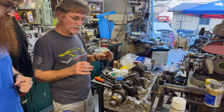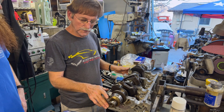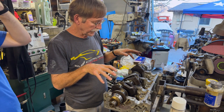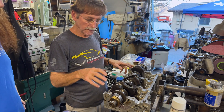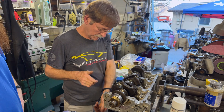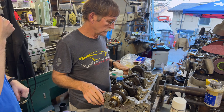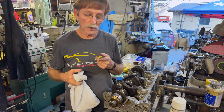I wanted a nice tight engine because these crankcases will expand two to three thousandths at temperature. If you think you can set them up at two thousandths clearance like a small-block Chevy or LS, you're going to grow two to three thou and then you're going to have low oil pressure. Chevy initially sold these with undersized bearings - this particular engine had standard on one side and one-under on the other half to take up clearance because of how the crank was initially ground. Line-to-line supplied me with absolutely perfect bearing fit.